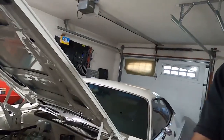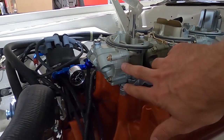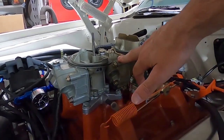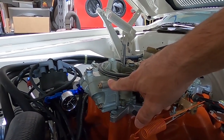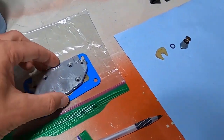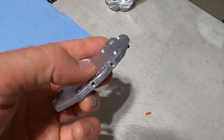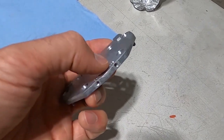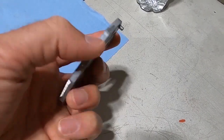Another thing specific to the outboard carburetors on the six-pack are the fuel metering plates. On the center carburetor you can do jet changes, but on the outboard carburetors from the factory they just have a metering plate that does not have jets. This is the factory metering plate and these are the main orifices. If you want to make it run richer, you have to drill these holes out — and obviously you can't make it leaner again after that.